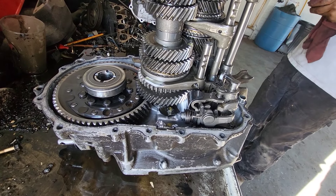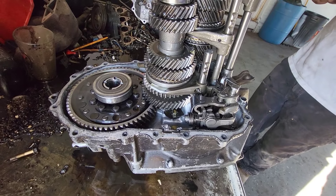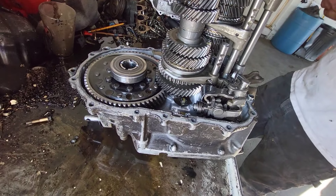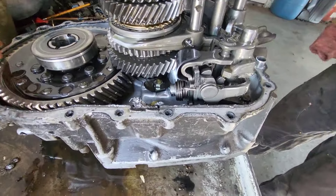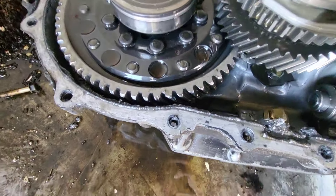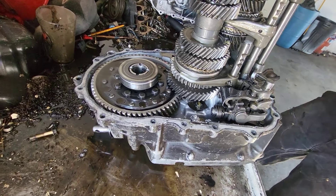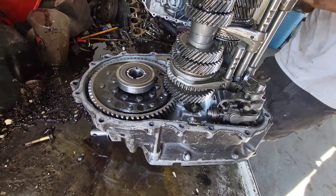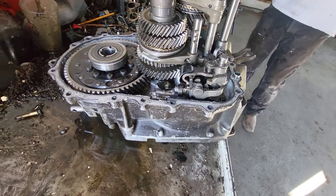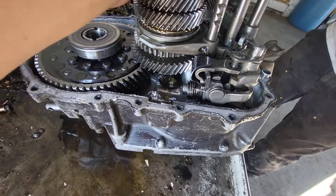It's a GSR with a 4.0 final drive — and it's a longer first gear. I'm hoping the rest of the gears are good, but this one's missing teeth too. This is an MFactory first gear. That's why I would end the eighth mile still in third gear, because first gear was longer and the final drive was longer.